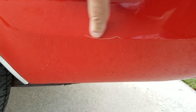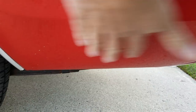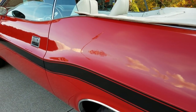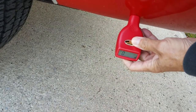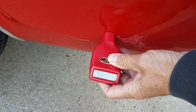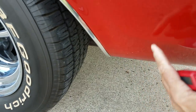Here we've got a crack in the paint where a patch in the bottom of the quarter broke loose. But there's no real obvious indication that there's filler there other than that crack. There's a little bit weaker magnetic adhesion right in this area on both sides. The digital paint meter didn't pick up any readings right in this area, but outside this area we did okay — 3.5. Right above it, 11.5, and there's a little bit of filler going up into here.